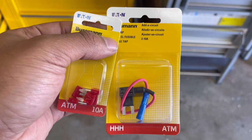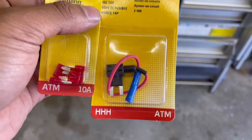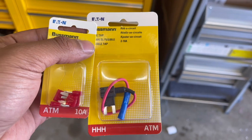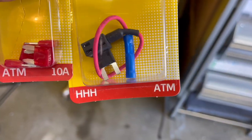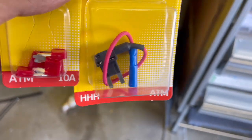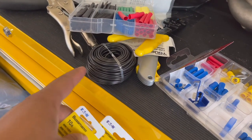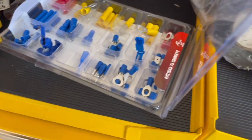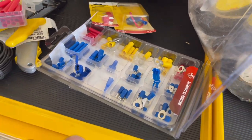What I have here is this fuse tap, and I have two 10-amp fuses because that's what this takes — as you can see there on top. I'm going to tap into this, use my extra wire, loom it through the engine bay, and then loom one of these as a ground connector on the already dedicated pins and wire it that way for the power and ground.